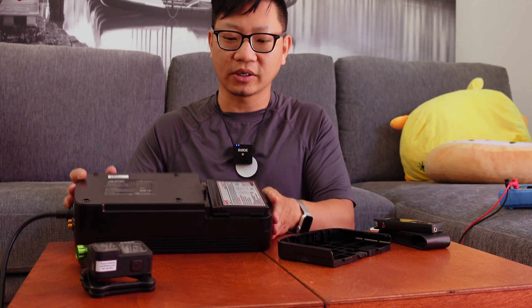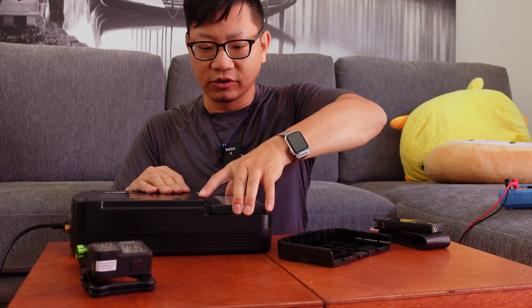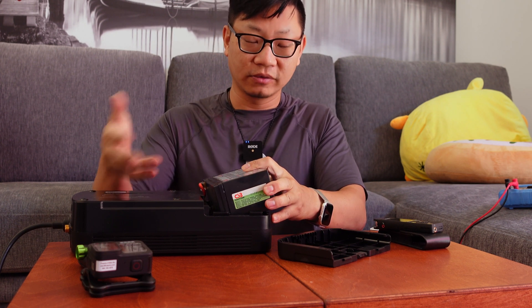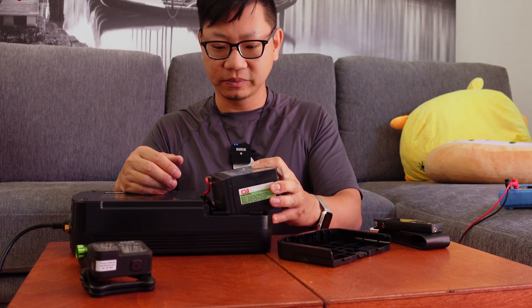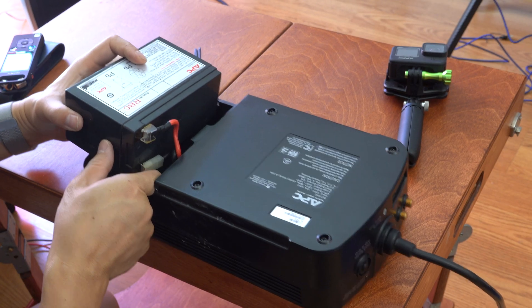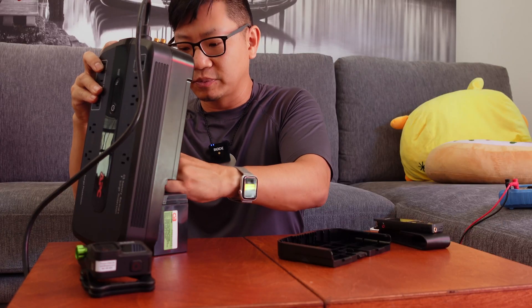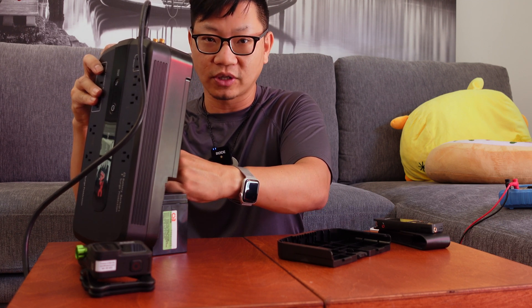This exposes the battery pack immediately — it's super easily serviceable. All you got to do is carefully take it out. There'll be two wires connected to it, usually red and white or red and black. Red is the positive terminal and black is the negative terminal. You're just going to carefully remove those from the battery pack. It's typically just blade terminals on this particular unit, and that's the case for most UPS units that were designed to be replaced.